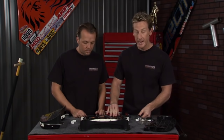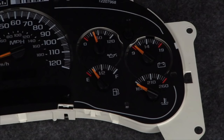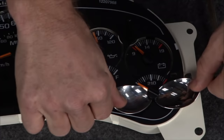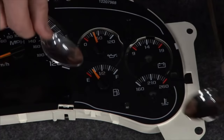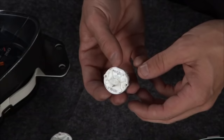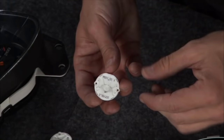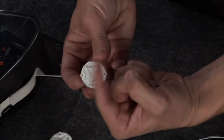We need to get this panel off and start looking underneath. Before you can do that, you need to get these little dial indicators off. The mistake a lot of people make is going in with a screwdriver and trying to pry stuff, but these are really delicate and they'll break. The trick is to use little spoons — pull on either side and they'll pop right out without breaking them. Once we get these out of the way, we can look at the little motors that drive these dials. These are the stepper motors — they read information from the computer and transmit it up to the gauges.